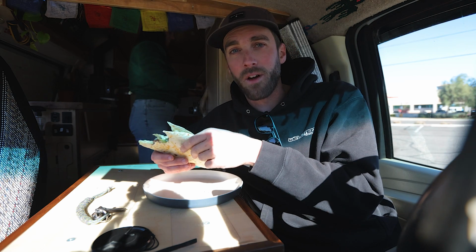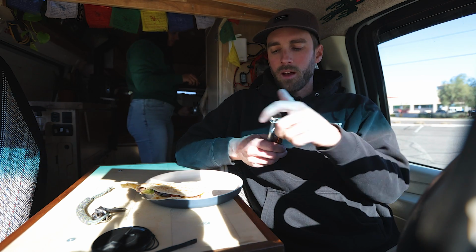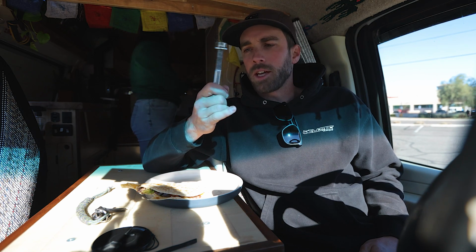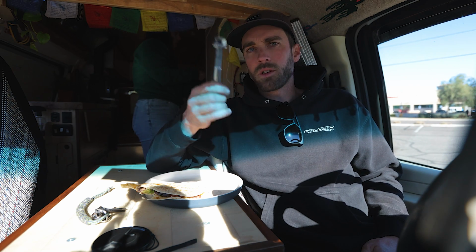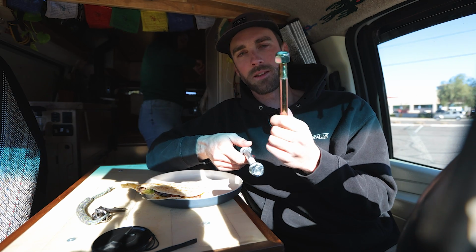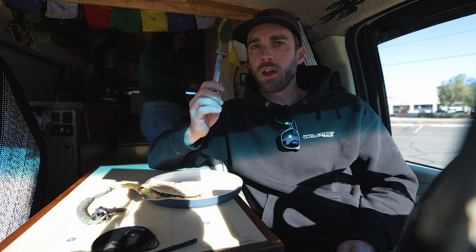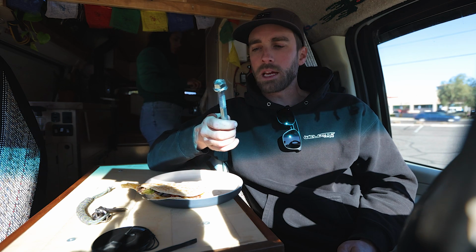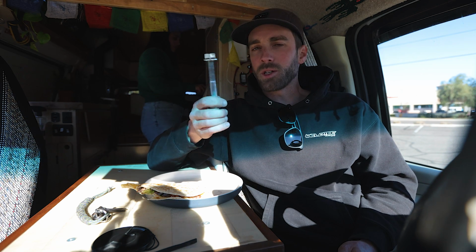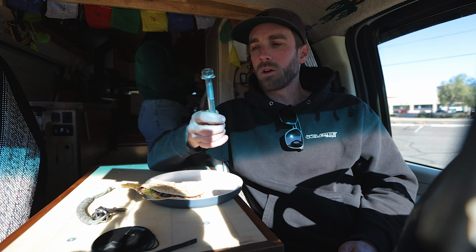And I think I may have finally figured out the issue. After a little bit of research and comparing, I put the bolt that came with the shackle into a little gauge, and I realized that 14 millimeters is actually smaller than 9/16. The Chevys are actually supposed to come with a 9/16. For whatever reason, they put a 14 millimeter bolt in the shackles that I got from Rock Auto, which are just that much smaller, giving you a large amount of play.